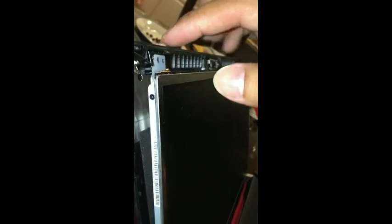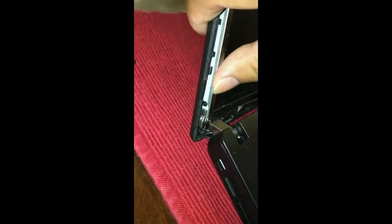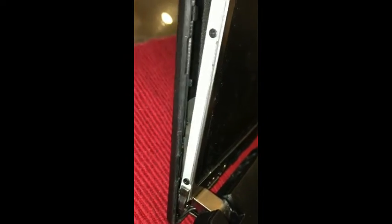As I was working through the screws on the side — there's three of them here — you'll notice that the one at the bottom is really tightly stuck in there and it's kind of hard to get into even at an angle. One way to make your life a little bit easier in terms of getting access to that screw is to slightly unscrew the two screws on the side down here.